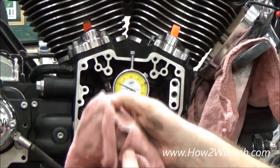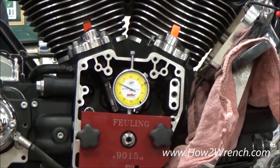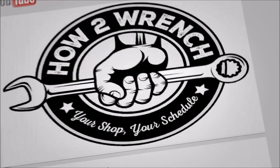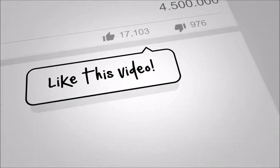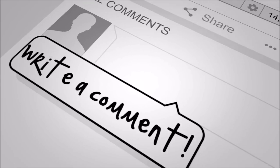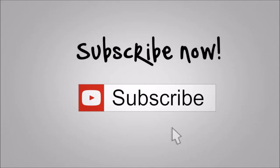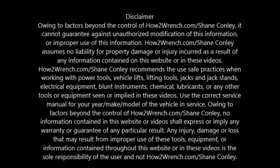That's a real good quick way to check with a specialty tool to see if your crankshaft has any runout. The crankshaft is just a little less than two thousandths out of round. We'll go ahead and note that on the work order and then look up the spec in the manual.